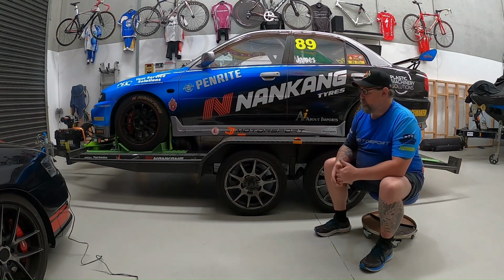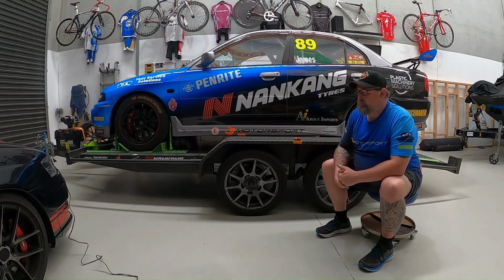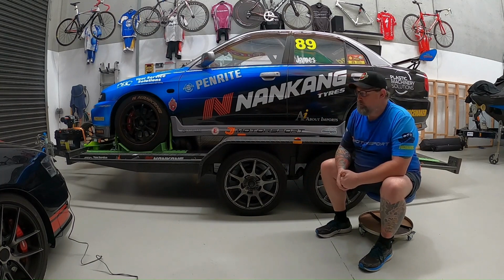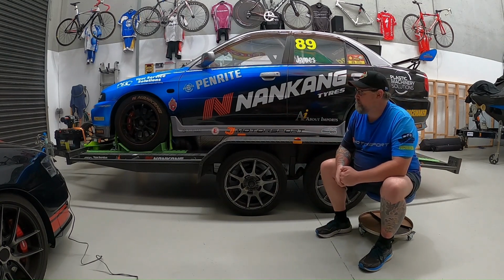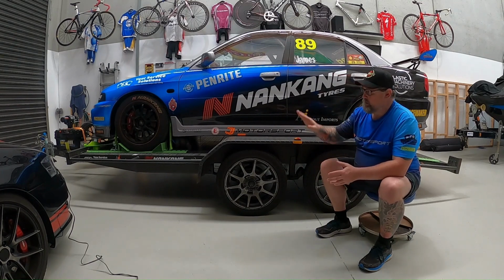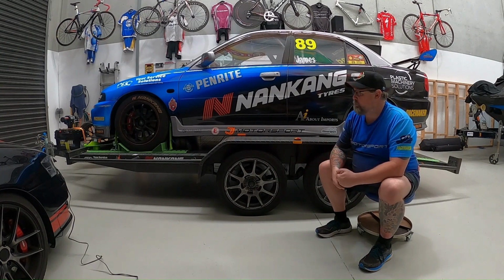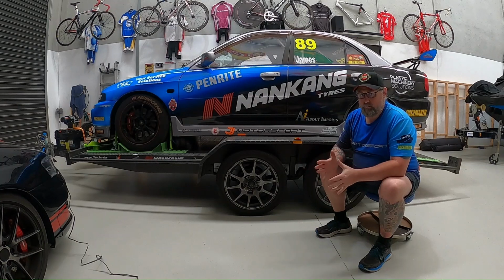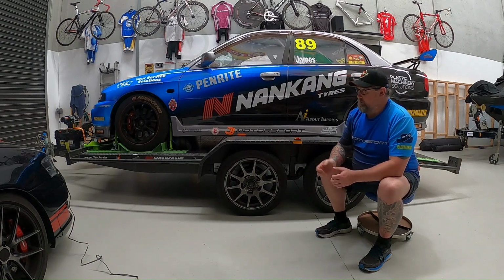Something else I needed to consider, being a low car at the front, is the way the lock and load systems work with their ratchets. You need room around the wheel to operate the ratchet. If you've got bodywork around each side of the wheel, it's not particularly easy. So something that appealed to me with this system is the ability to use the idlers, which I'll show in a bit more detail. You can use these idlers to make the strap come out on a bit of a flat angle to get it away from the coachwork or the bodywork on your car. That was particularly appealing because with lower vehicles it's difficult clearance-wise to put ratchets close to the tyre, as well as having the clearance on the vehicle to make it function properly.